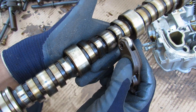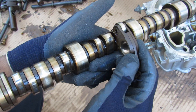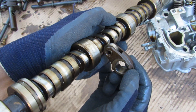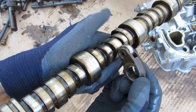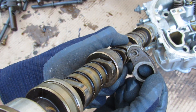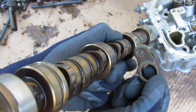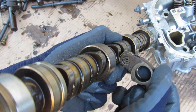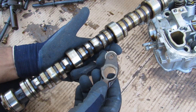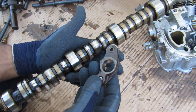Taking a look at the camshaft assembly, the three lobes that control the intake each have a rocker arm with a roller that always follows the cam profile. The two outer profiles are exactly the same height and width, but the middle VTEC profile is a little bit taller — there's a bit of a step — allowing that valve to open just a bit more. It's also wider, meaning during the rotation of the camshaft the valve will be open for a longer duration. Technically you could have multiple profiles with three or four VTEC switchover points for higher and higher power, but things get really complicated under the rocker cover.